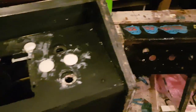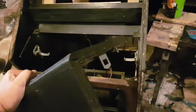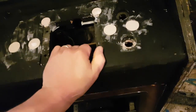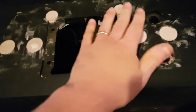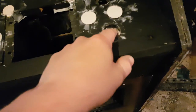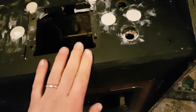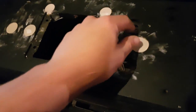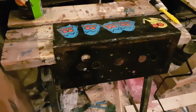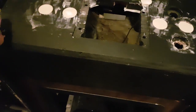I've taken apart the metal and the wood — the back of this is actually wood. I'm filling the holes: I've put tape on the back and I'm essentially filling pretty much every extra hole that was drilled. These six holes were still there — they'd been filled with a thin plate of Bondo or something similar on two sides. I've stripped the top, which was the easiest to strip — just scraping with heat. Now I'm using paint remover, letting it set for a few hours. I can see bubbling already, so it's working.